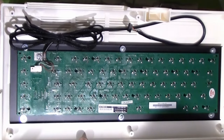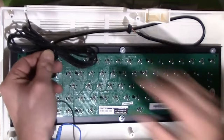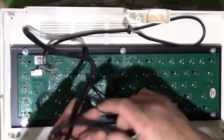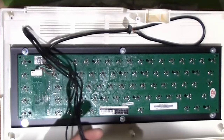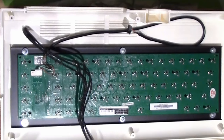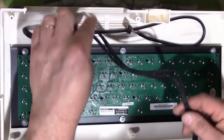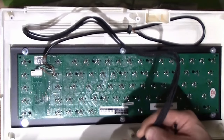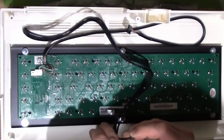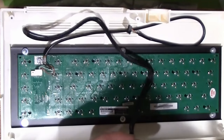Now for the top half of the case. There are a couple of things to prep before fitting it to the bottom. There are four wires that will float around inside the case, so we need to manage them. Disconnect the earth strap temporarily. There are three bends in the wiring harness — put a cable tie on the outer two bends to join the wires together as one bundle, keeping it neat inside the case. This is what cable management is all about — keeping cables tidy within the case.